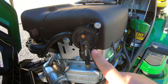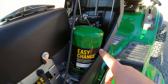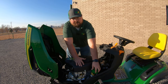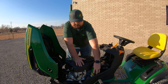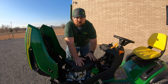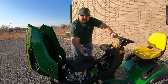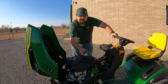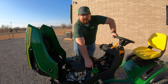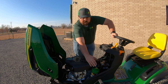Moving down on our left hand side we have our fuel filter. Then right back here at the back we'll see the large easy change oil system filter. This is a pre-filled filter — to change the oil we simply take this filter off, buy the new filter, put it on, and that is all it takes to change the oil on this model. If you're skeptical of this system you can always buy the kit to change back to a normal filter and drain system. But as it comes from the factory you will not have a drain — you simply change this filter out, which removes a portion of the used oil and refills it with new oil and a new filter.